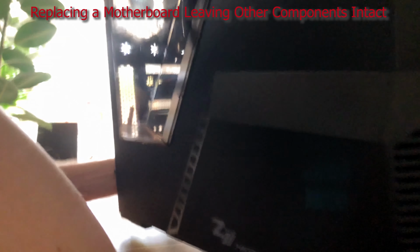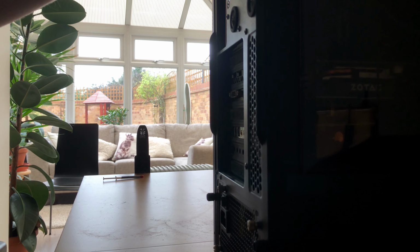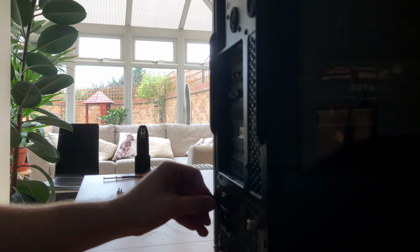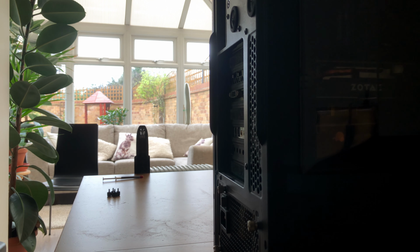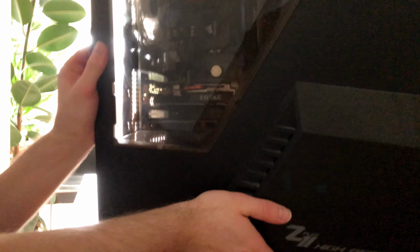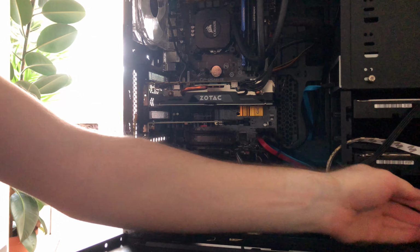So today I reinstalled a motherboard. I got an old one out and put a used one in because I suspected the motherboard was faulty, as I needed to boot twice to get to the login screen, and sometimes in the BIOS it took a long time until the mouse did not lag, probably about 5 minutes until I could actually move things around on the screen.